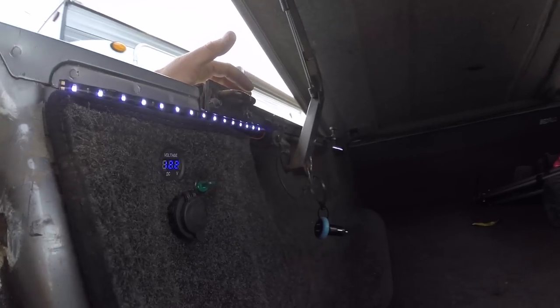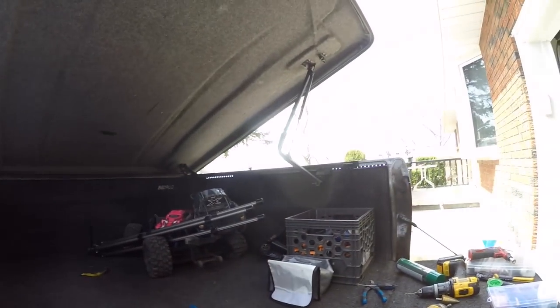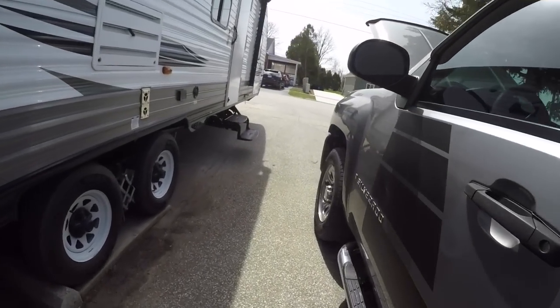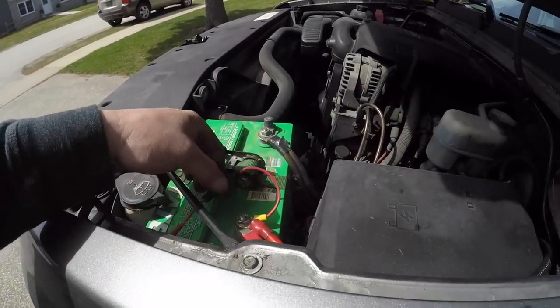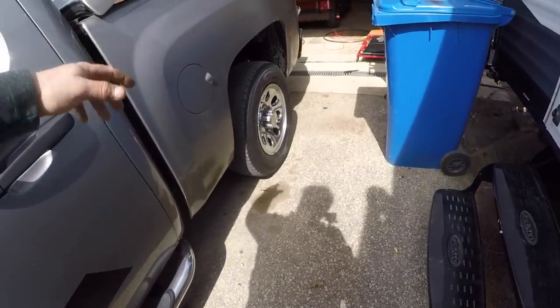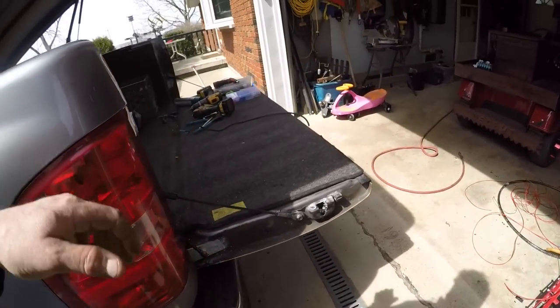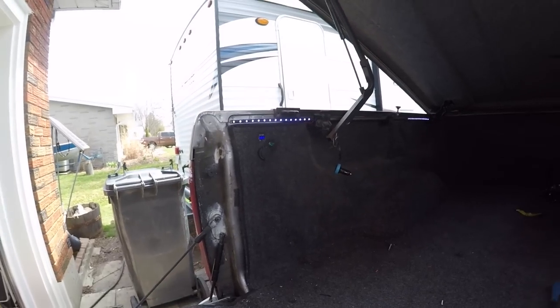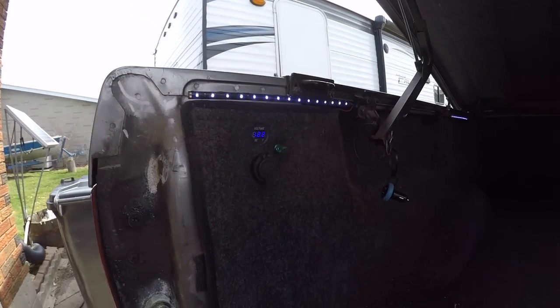I got all the wire connections in here for that. I ran a 12-volt line right from front to back when it was up on the hoist, and I got myself a fusible link at the front of the battery. So that's how you do her — it's grounded to the box, because the box is grounded. That's a nice little job there, if I can say so myself. Looks factory.